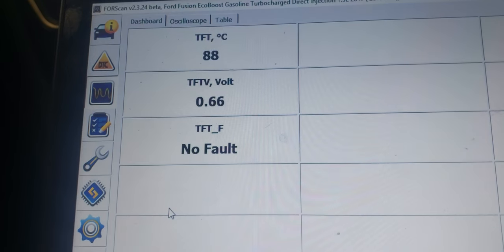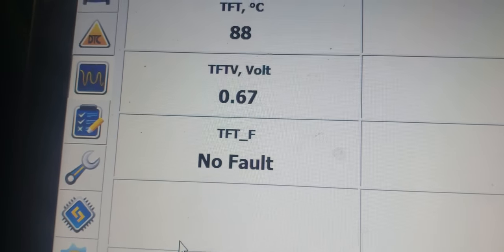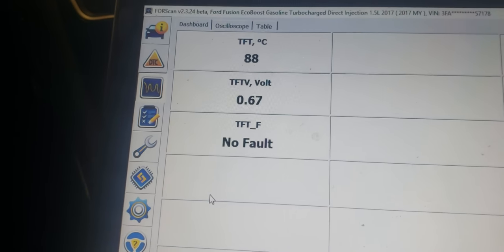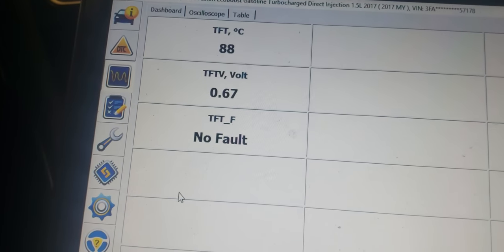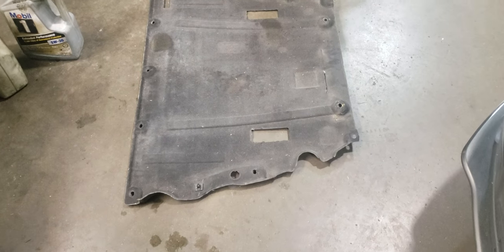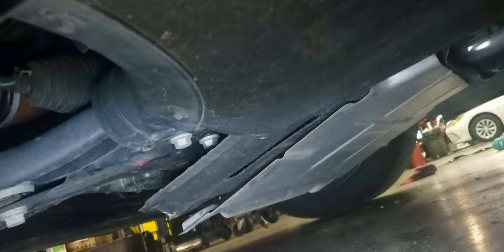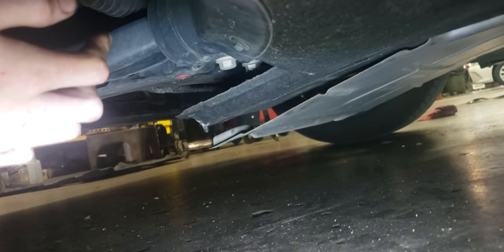Just got back from the road test — it's at 88°C, which is about 190°F, pretty close to 200 degrees. I'm going to lift the car back up and loosen up that overfill plug. One thing I will say: before you go on the road test, make sure you put the skid plate back on. I learned the hard way — I got up to speed and heard a thumping sound. That metal plate was flapping in the wind. I thought it was the transmission at first. So zip that down before your test run.